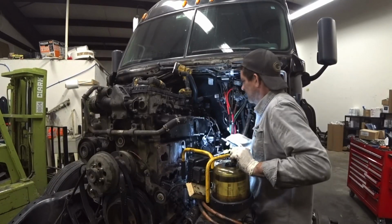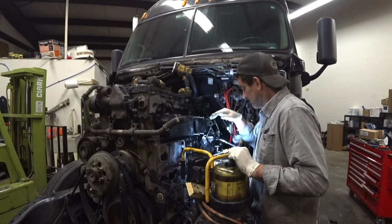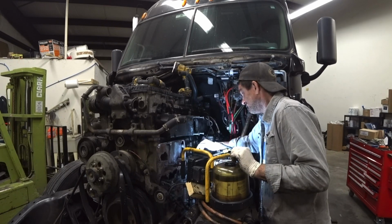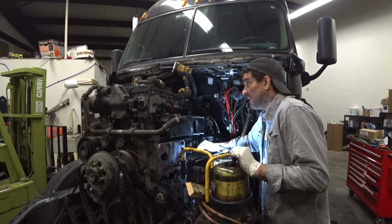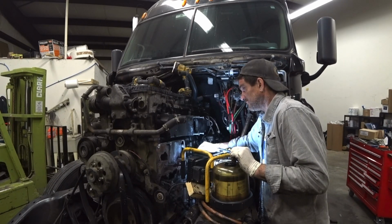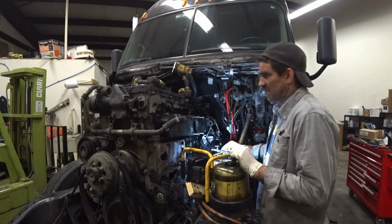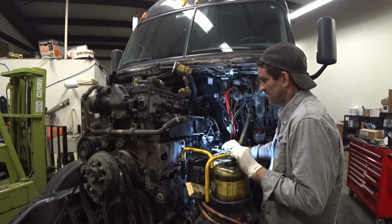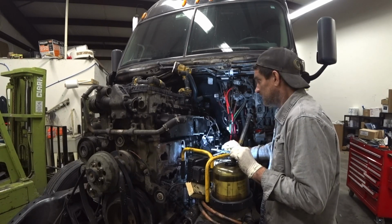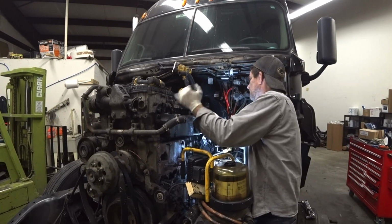You guys saw, basically this thing was so caked inside. It was all full of oil and everything. I tried wiping it out, but there was probably about a 1/4 inch of just grime in there. It was all carbon and stuff all built up. It was really bad. It was really caked in there bad. I really don't know how the sensor was reading. So I pulled the sensor out of it, and I actually put a bunch of degreaser and scrubbed it up a bunch, and then I stuck it outside and used a pressure washer with hot water. Got her pretty nice and clean. So now I'm just going to go through and just got to torque them down.